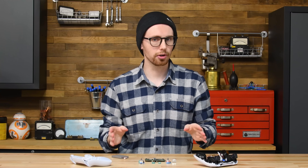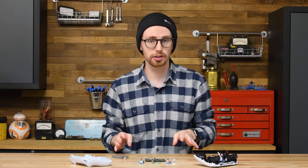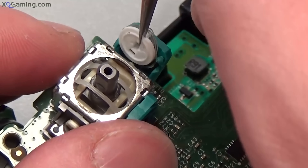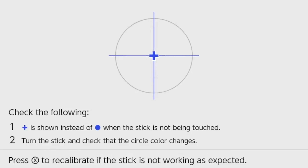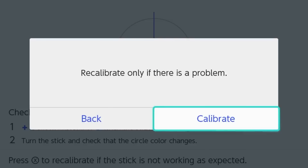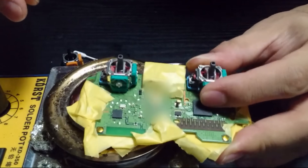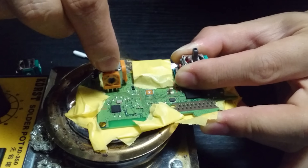If you don't want to solder, there are plenty of YouTube videos demonstrating fixes that don't require heat — just a lot of patience and maybe some fine motor skills. You could pry off the potentiometer housings and either clean or replace the rotating wiper, or carefully clean both the wiper and its graphite track. Some consoles and games offer joystick calibration, which can help put a bandaid on some drift issues, but it's not a permanent fix — you're basically just giving the joystick a new software center point or telling the game to ignore inputs within a small radius. There are also fixes that do require soldering, including a really cool way to attempt a whole joystick swap with a soldering pot, though even those don't always guarantee a fix.